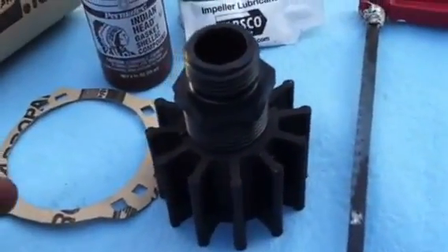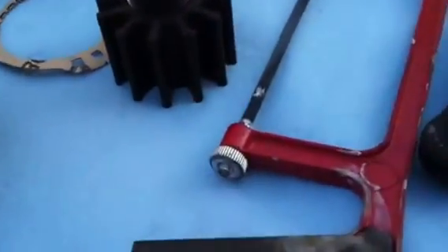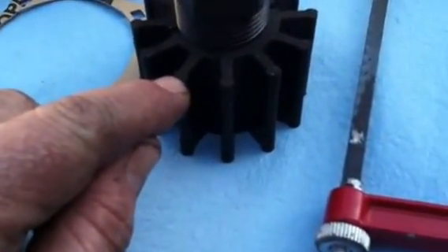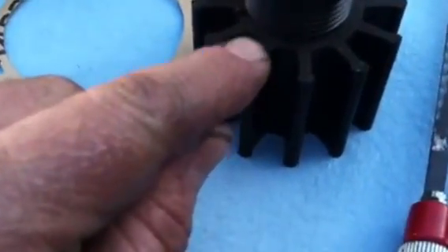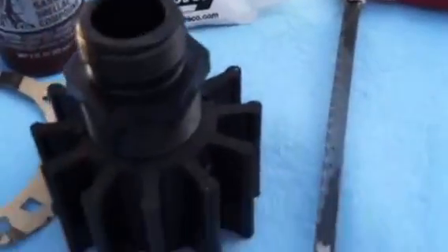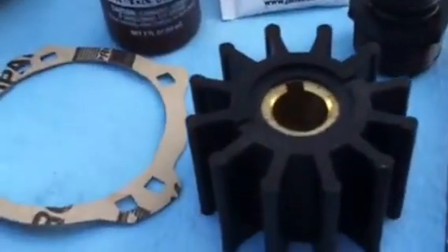Make sure the vanes are going the right way. I use this little copper block — it's small, fits in the tight area well — and I just tap it in gently. You can't whack this thing in like Magilla Gorilla; you've got to be gentle and take your time, make sure everything's lined up. When it's all the way in you might have just a little bit of the top vane sticking up above, but that's okay because the cover plate accommodates that. Make sure you get lubricant on the cover plate too, because it butts right up against the impeller and has to run smoothly.